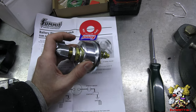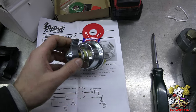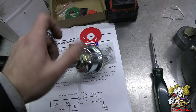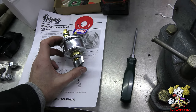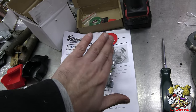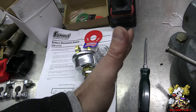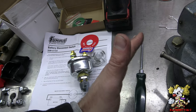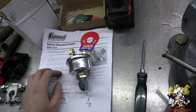Also, some people put these in for the track. When they're driving the track and something goes wrong, for safety reasons they can go ahead and shut this off. When you do that, you've got to put this in the NHRA legal way, which means you have to isolate on one side the alternator and the battery, and the other side is the ignition and everything else that powers the car. So when you shut this off, it shuts off the whole car.